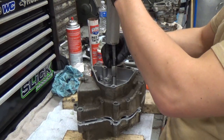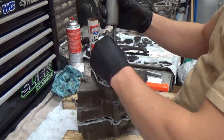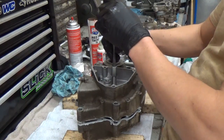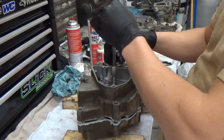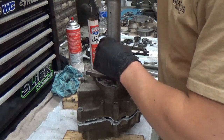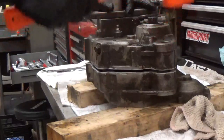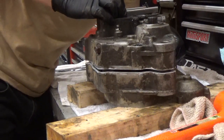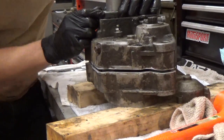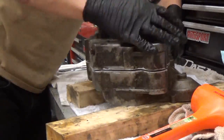I'm going to put the nut on the crank threads and put this piece of all-thread back down on it. I would probably just recommend buying something from Rocky Mountain or Motorsport that fits your application so you don't have to worry about screwing anything up. For me it's just easier to swap out the all-thread piece. The bar stock distributes the weight evenly so you're not scratching up the cases. I'm just cranking down on that top nut. The back side always gets hung up because most of the pressure is up front, so I just lightly tap the back side of the case with a rubber mallet.